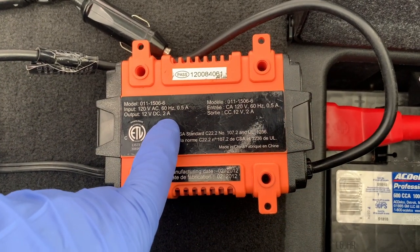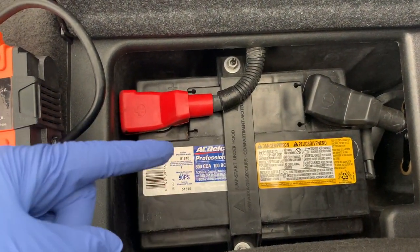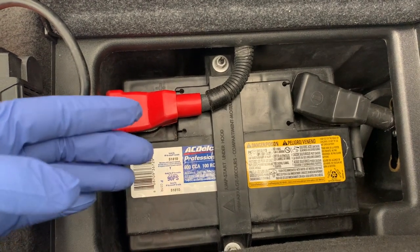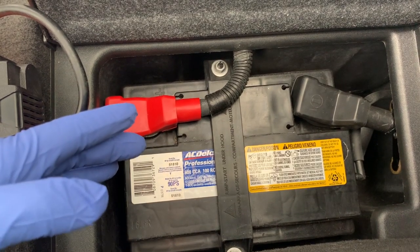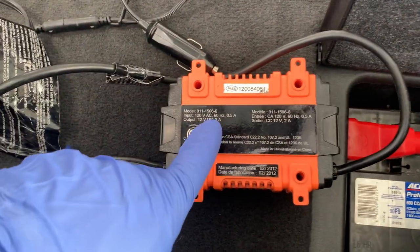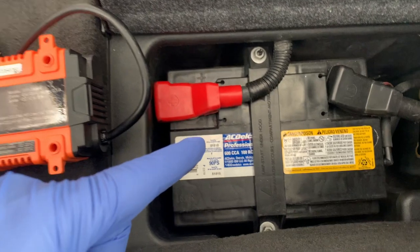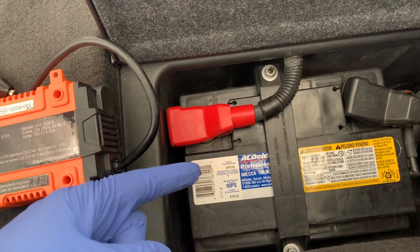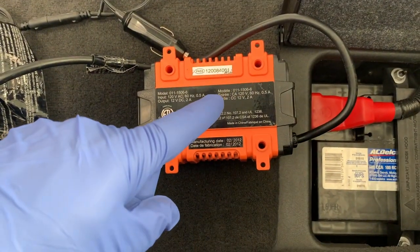You also want to get the right amps relative to the size of your battery. The rule of thumb is 10% or under of your total battery's amp-hour capacity. An average car battery has the capacity of around 48 amp-hours, which means that fully charged, it delivers 1 amp for 48 hours, 2 amps for 24 hours, and so on. So if you had a 48 amp-hour battery, a 4 to 5 amp charger would be perfectly fine. But a 20 amp charger would likely lead to overcharging. This is a 60 amp battery, so I could go up to a 6 amp charger if needed — but at 2 amps, this is absolutely perfect. Keep it slow and steady by following the 10% or under rule of thumb.